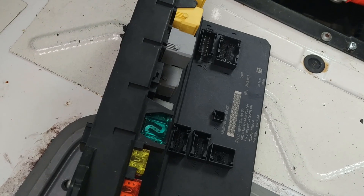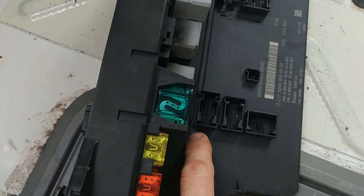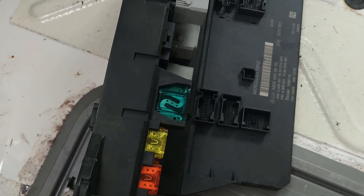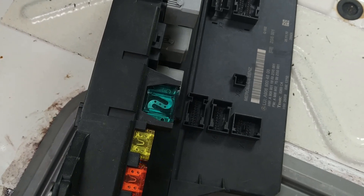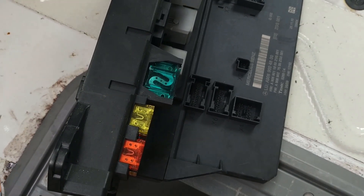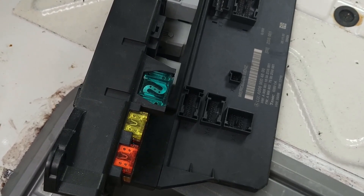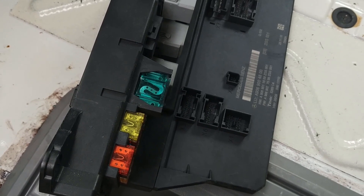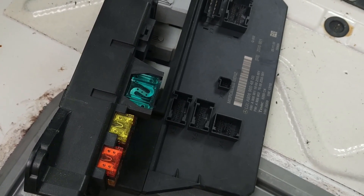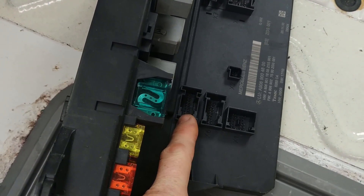I've just finished the cable to H3 at the back of this supply unit. About to put it back in, I noticed the connector for X3 had a bit of black tape round one of the wires — I don't like black tape, bit suspicious. I took it off and sure enough the wire had been badly stripped and damaged. These aren't thick wires anyway. I checked the wiring diagram upstairs and X3 pin 14 is the feed to the reversing lights. I decided to repair that cable, and while I was at it I've taken a wire off that one as well, because I need an input to the reversing camera and also an input I can operate via a relay for the scene lights I've fitted on the side of the van. They're going to work off the reversing lights as well as internal switches. So — X3, pin 14, reversing light output.